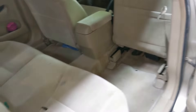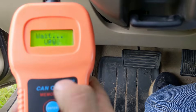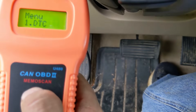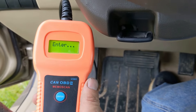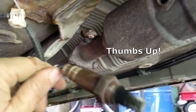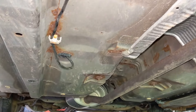With everything installed, go ahead and clear the P0141 code. Use your OBD2 scanner, locate the diagnostic port under the dashboard, plug it in, and follow the prompts to erase the code. I did this repair about 6 months or 12,000 miles ago and the P0141 error code has not returned, so this fixed my problem. Subscribe to this channel for more helpful videos for repairing your Honda Accord.